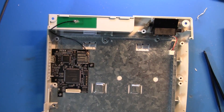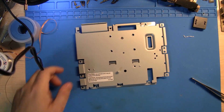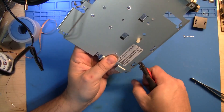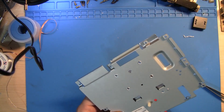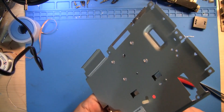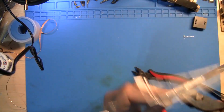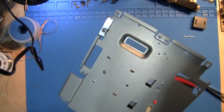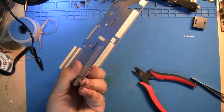Now we're going to switch cameras. For this heat shield, where you put it on, we need to modify it right here. Just use side cutters — we're going to snip right there, make one cut or one little snip. Then take a pair of pliers — all we're going to do is bend this up. We're going to flip it around. There you can see we have one nice little opening.